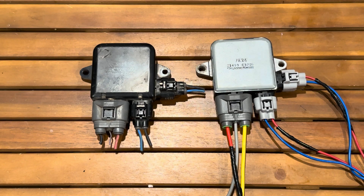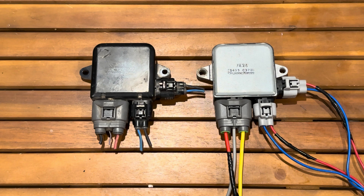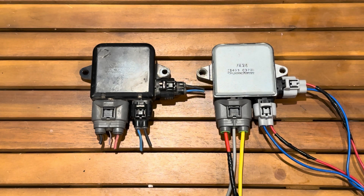These units are typically used on dual fan configurations, but I've also seen them used in single fan setups or with two units used together to control high-current dual fans. You can control two fans by keeping each control lead going to a separate fan motor. Pay close attention to your wiring here because switching the two wires on this plug will fry the unit. They're not that expensive, but double-check before you hook everything up.